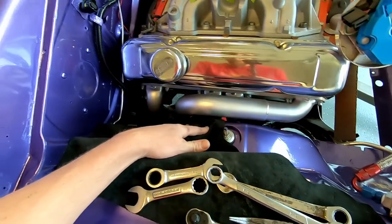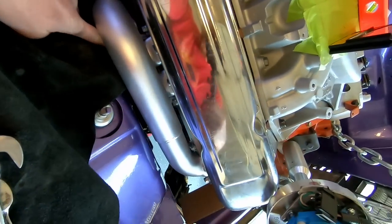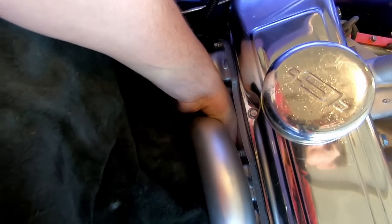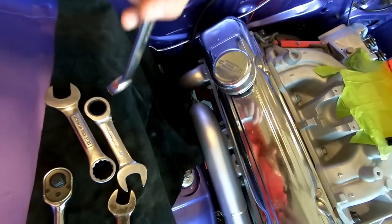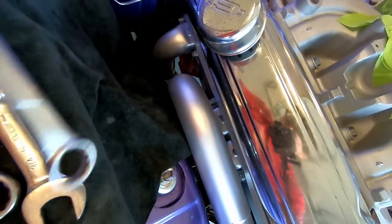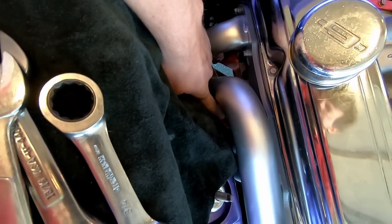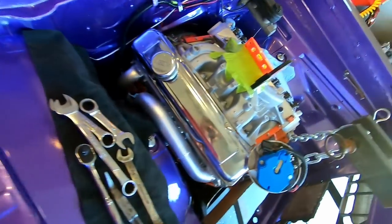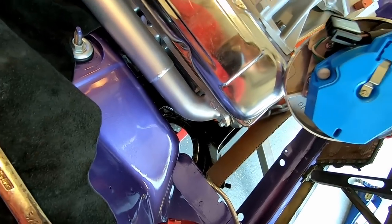I've been putting the spark plugs in this side and this number 6 spark plug has been the hardest thing in the world. You can get your fingers like here. And I can get my fingers like that, but I then have to take a 3/4 wrench and get on the end of my socket. So in the future, I may cheat and drill me a little hole right there. If I ever take this engine out, that would be in line with that, that I could stick an extension through here somewhere. If you could just stick an extension in a ratchet, that would be a lot faster. But the other 3 have been a breeze, so I'll bring y'all back and show you what that looks like after I get my ears mounted.